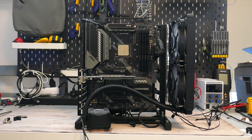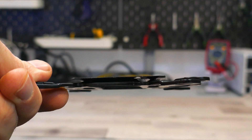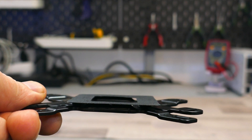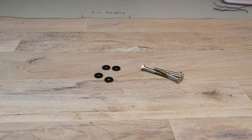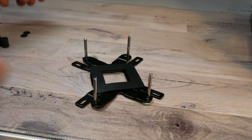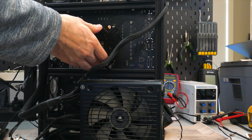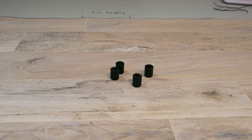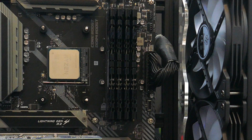Now to install the block, you should have your motherboard already mounted in your case. Find the provided backplate and spacer. Peel the paper off the spacer and stick it onto the groove side of the backplate for AMD — or the non-groove side for Intel — as this is the side that will be touching the back of the motherboard. Find the provided throughbolts and plastic spacer holders. Slide the throughbolts through the corresponding holes for your socket, then slide the plastic spacers over the throughbolt screws to hold them in place while you align the backplate to the holes on your motherboard.